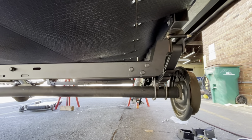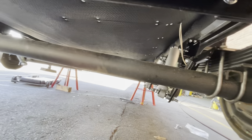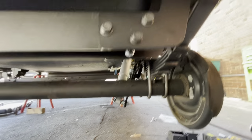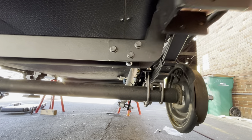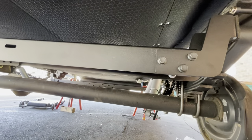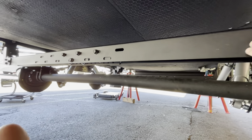While I'm underneath here, I'll show you the actual bracket that's different. This bracket right here is basically the same bracket as there, but you see the difference — this would keep that cross beam going straight, which would have put that cross member up here. We needed the drop-down in order to gain the space for the dump valve back there, so we went ahead and did it on both sides. That also makes it easier if you need to get up inside the underbelly material — you don't have to take this completely out.